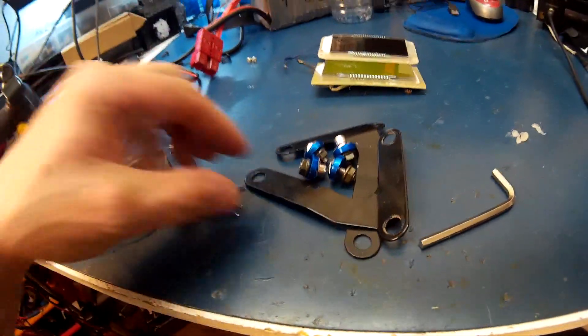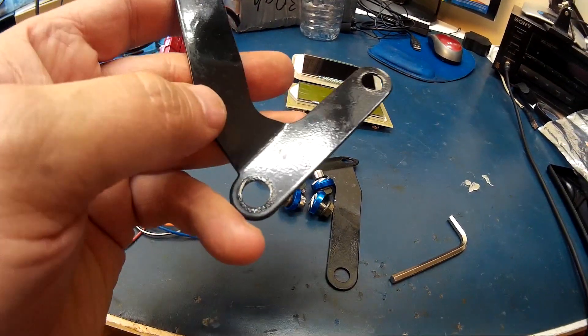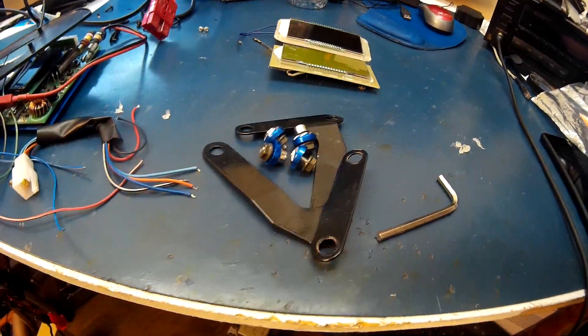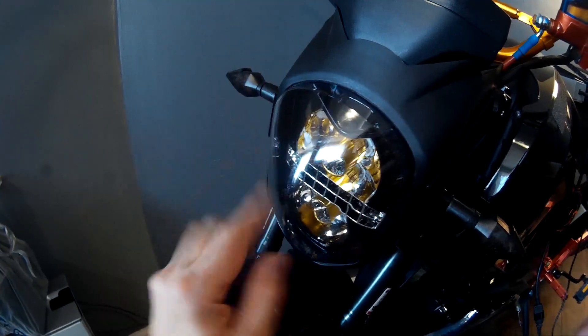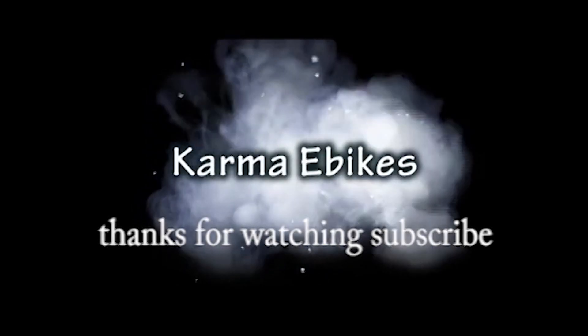Before I go, I just wanted to show you how cheap some of these bikes are. There are pitted rust marks all over the fairing holder, so it's not going back on any time soon. The way the fairing is set on these bikes, the fairing overlaps the headlight, and it's so close that any dirt falling in vibrates and scratched up the lens pretty good. I recommend removing the fairing — besides, it gives it more of a Grom look anyway.